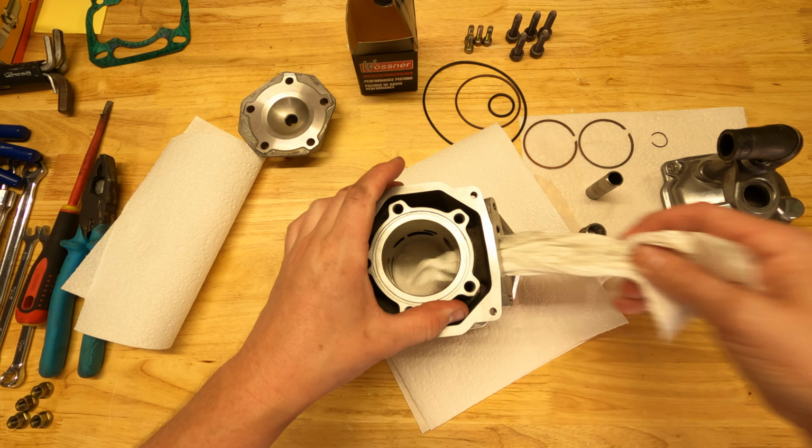So, to improve the piston squish on this engine, me and the engineers decided that we should remove 0.5 mil from this surface of the combustion chamber. By removing 0.5 mil, we've now got this internal surface here closer to the head of the piston. 0.5 mil has given me a piston squish of around 1.2 now, which is much improved from the 1.7. I'll insert the maths here.